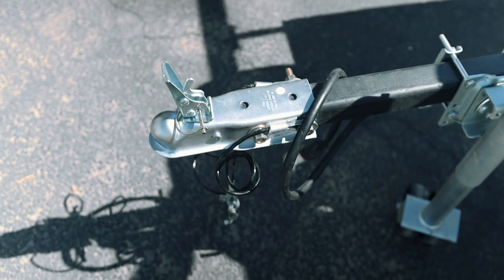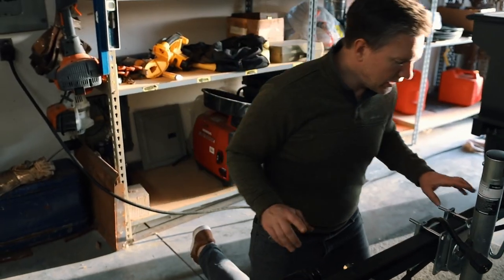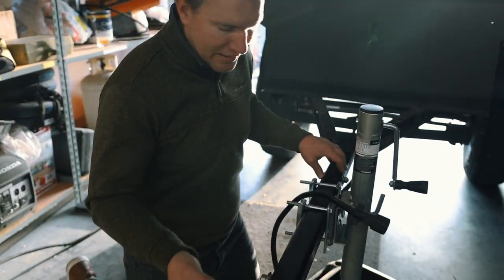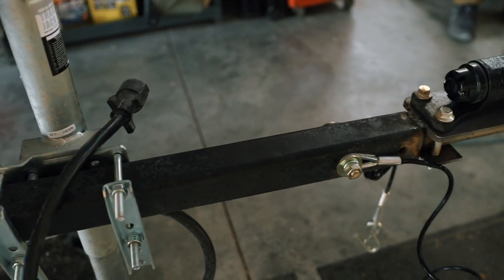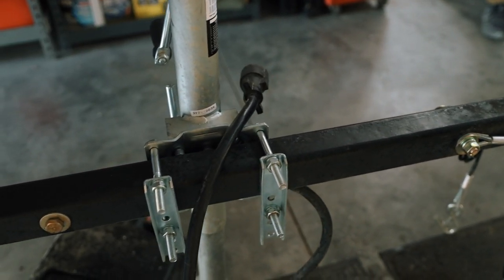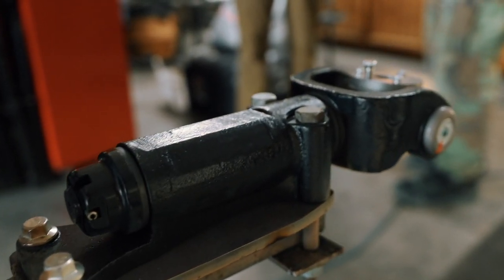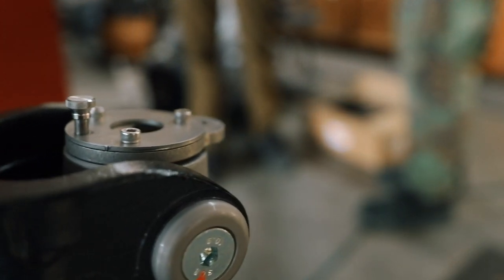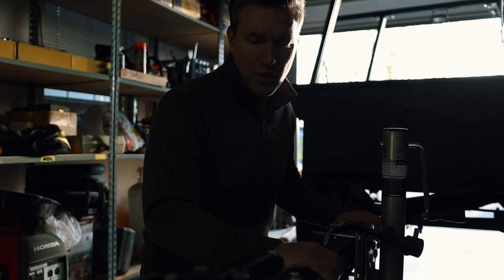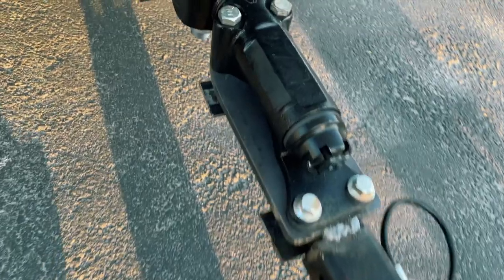With all of this together, this is exponentially — 10 times stronger at least — than the ball hitch we had before, which was aluminum with just a couple bolts holding it on. We put a metal tube inside a metal tube, welded it, drilled two Grade 8 bolts through both, and we all feel very confident that this is going to be as strong if not stronger than before because it has more steel in it. The last thing we did was attach it to Ripley for the drive home and it fit perfectly. This is going to be an awesome trailer.